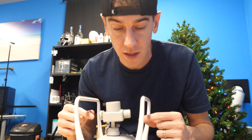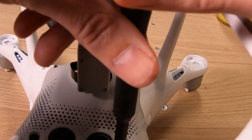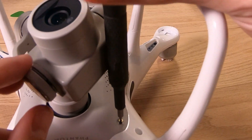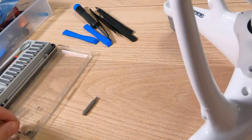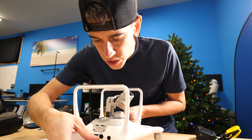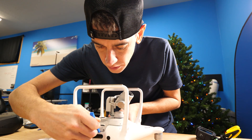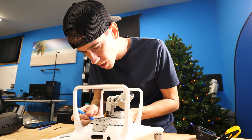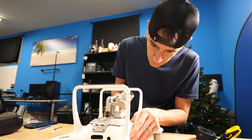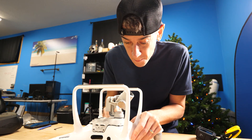The first thing to take off is the camera. You're going to need a 1.5 millimeter hex bit to take out eight of the bolts holding the camera assembly to the bottom of the drone. Now that we've got all our screws out, you want to gently pry — it's probably better to use a plastic pry tool — because there are a couple cables on the underside of this camera housing and we want to make sure we don't mess any of those up.